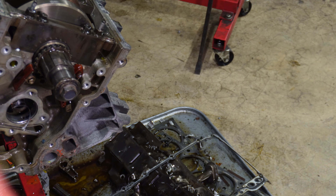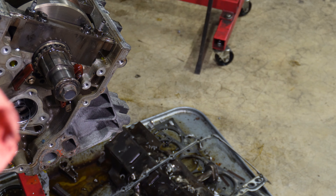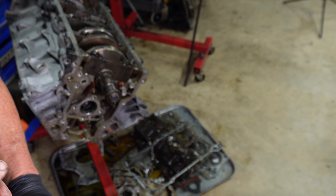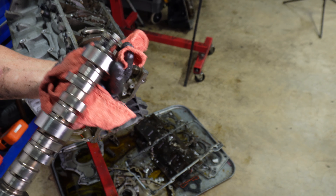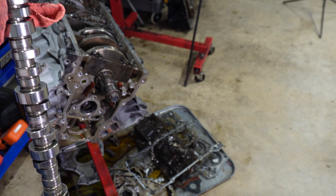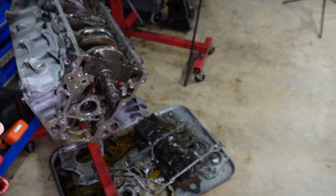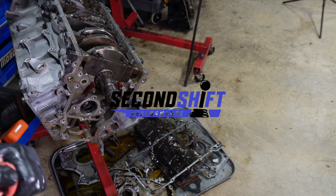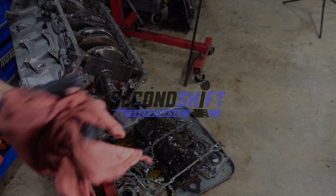When I run these numbers, I don't find anything under comp, but I find a BTR Stage 4 cam. A Stage 4 cam is firmly in the land of: you don't care if it comes apart as long as you're making your power. I myself prefer to go a different way, because I like things that last. Hot cams have bad idles, they're pigs on gas, and they don't blow clean smog. At the end of the day, there are better ways to make power.